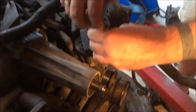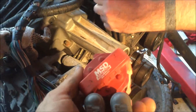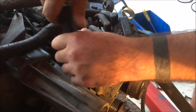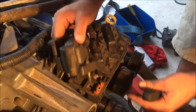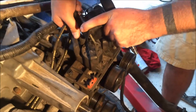While we have the pulley off, we're deciding to swap our ignition packs over to MSD ignition, really only because it was on the other car. The ignition packs are interchangeable between the standard EcoTec and the L67s, so if you have them you may as well put them on.